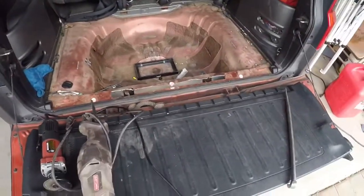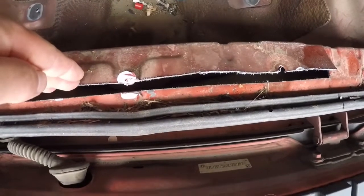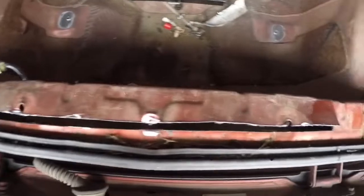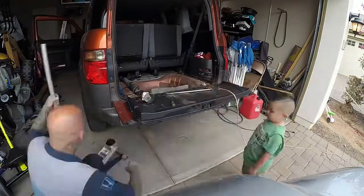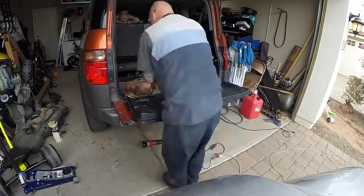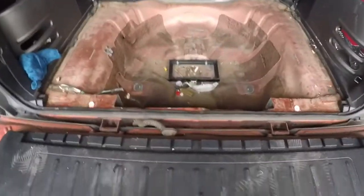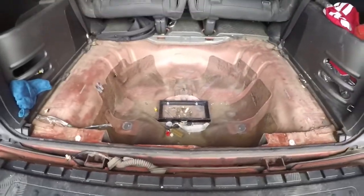Nice to go back at it. Trying to put that fuel cell in the spare tire area — I'm going to cut this out. The edge of the cell is kind of right here, and the sump will be at the very bottom at that point. I'm not sure if I'll have to cut the bottom out, but I'll have to cut out this area so the sump comes through. Alright, so we got it all cut out — kind of a rough cut. But I cut through my wires. Way to go. Then we're going to see how the cell fits without cutting anymore.